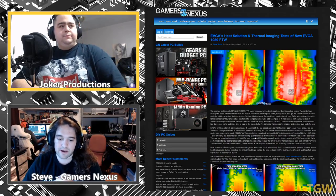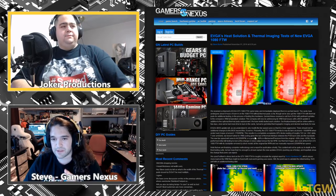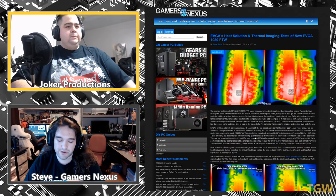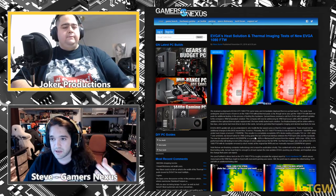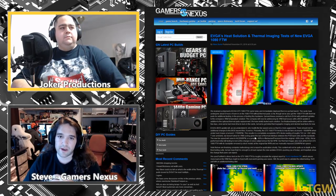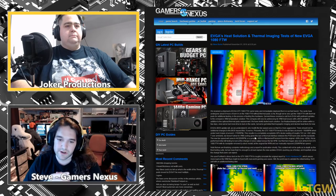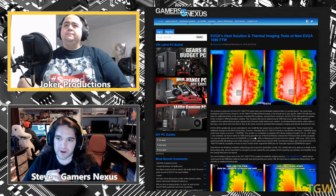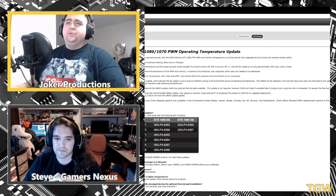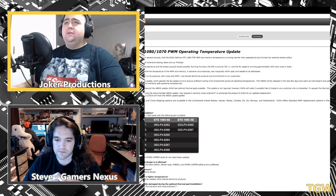Quick clarification: VRMs can handle T-junctions of 150°C, with power stages doing 100°C continuous recommended. The highest seen here is 109°C, so EVGA is pushing that line. One theory: at higher ambient temperatures the GPU core temp increases, which increases fan speed — because the card's BIOS controls fans based on the GPU diode, not based on the VRM temp. Also important: putting these pads on does NOT void your warranty — EVGA has said even if you install them incorrectly, they'll still back you.